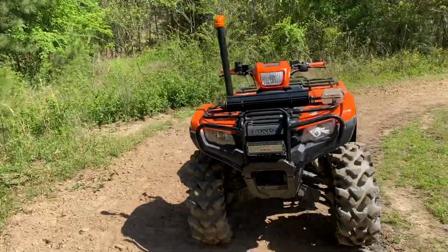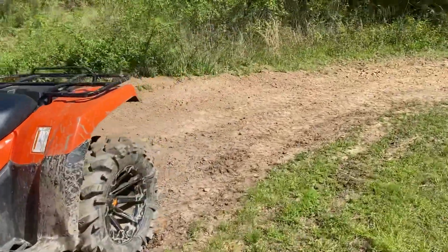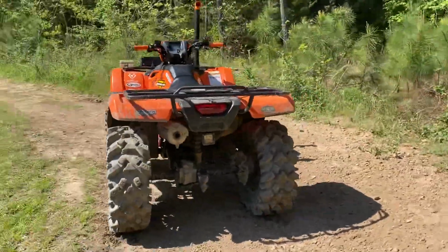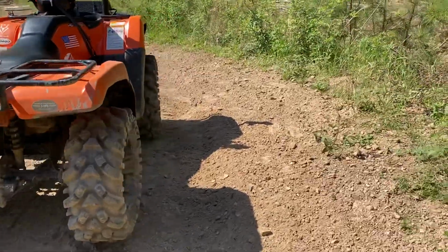The farther the A-arms are pushed down, the skinnier it gets, but the axles limit that, which it just has cranked up shocks, and I should be able to run the 31s. There's no point for a lift really on an SRA in the back, just to make the bike sit level is all it's for.